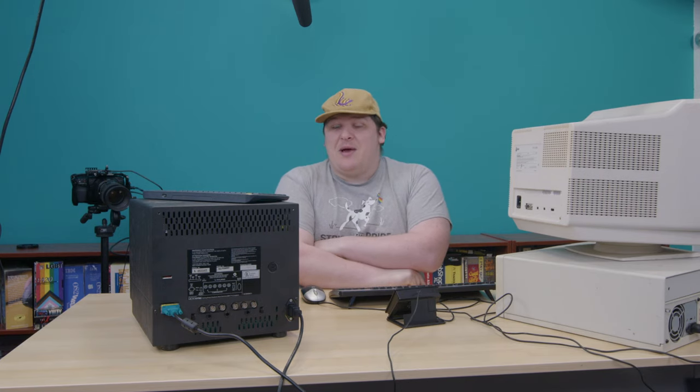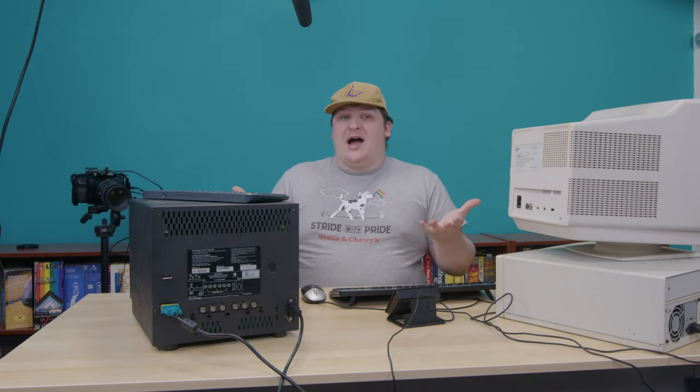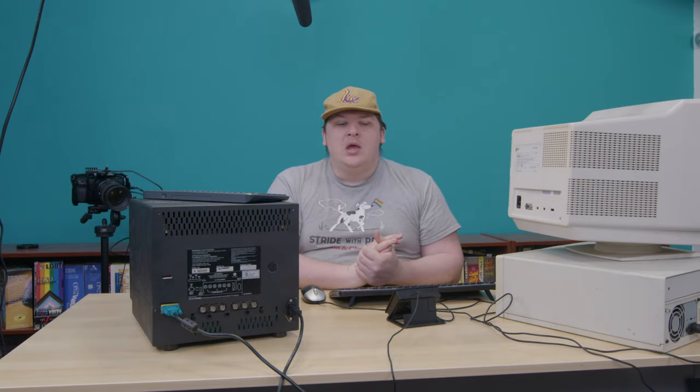And then EGA came out, and the same thing happened. There were Super EGA cards. That's what I have in here. Register-wise, it is interface compatible, ABI compatible, if you will, with the IBM EGA card. It behaves exactly the same, except you can also ask it to do other things that the EGA card wouldn't do. And it has certain capabilities, like the ability to convert